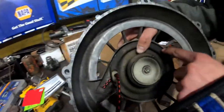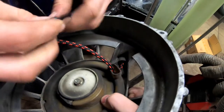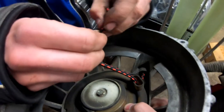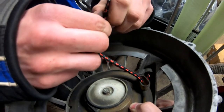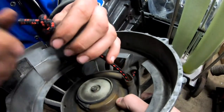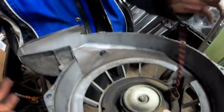Now we'll tie our knot. The whole time this is going on, I'm holding the tension tight exactly how it was when I took it apart — I'm holding with my finger. You can always take a vice grip and lightly squeeze, and then if you don't have another guy to hold it, that works too. What I do a lot of times when I do snow blowers and a lot of stuff — I tie a knot kind of closer to the end and work it up. I think this one I might be able to just do a single knot, or maybe we'll do a double where I double knot it again. But the channel doesn't have a very big sitting area. I want to get two pairs of pliers and we're gonna have each of us tug on each end of that, and once that's done it's never gonna pull through.